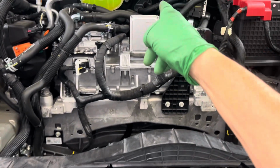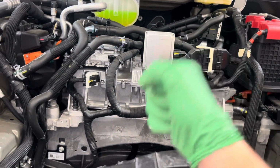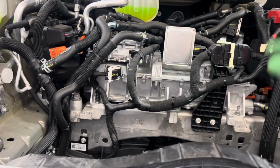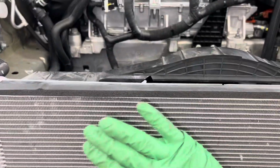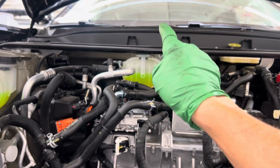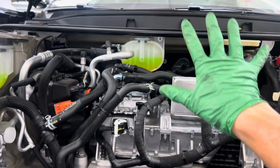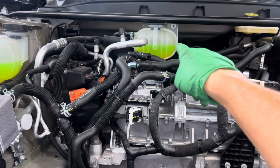And so there are times where not only do the passengers need heating, like if you're in some place where it's snowing and you need instant heat, well, there's no engine on here to make coolant, and there's the compressor right there. So what it does is it takes the heat from outside, it absorbs the heat, and then it compresses the heat. This turns, basically think of this turns into the evaporator, and the evaporator in the car that you know it as, the heat exchanger, we're gonna learn how to call them all heat exchangers, that evaporator inside turns into the condenser.